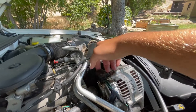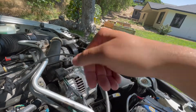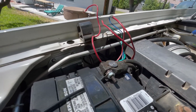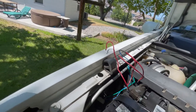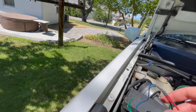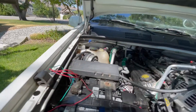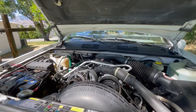I put the power on the blue wire. This has to go to a keyed-on power — I actually just wrapped it around a fuse in my fuse box here because I didn't want to tap into the wiring or destroy anything. The two wires go through this little loom I made and connect to these two little posts right under the back of this box. Then you put the ground to the box down. Make sure you ground out and clean the inside of the fender where you mount it. It needs a good ground. One wire gives it power and goes to one post on the alternator; the other goes straight to the other post. The wiring direction does not matter.